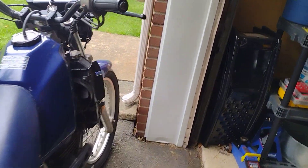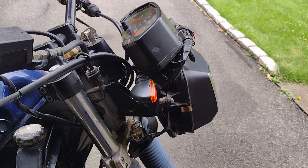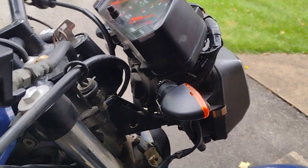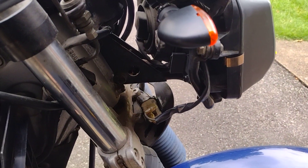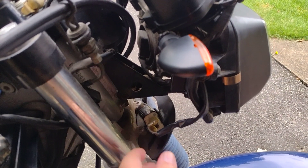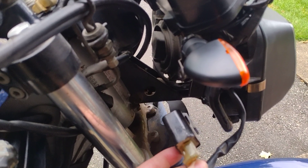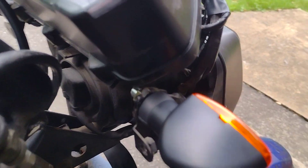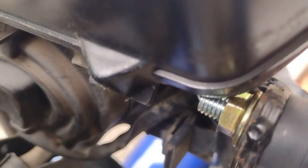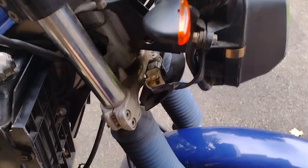So I came up here to the front where the wiring harness is, and it literally took me about two seconds to find the relay. Right here, underneath the right turn signal, the relay was literally just dangling there. It wasn't even attached where it was supposed to be attached. See that clip on the back of it? That clip is supposed to attach to that rubber harness in there — it wasn't even attached, just hanging there.